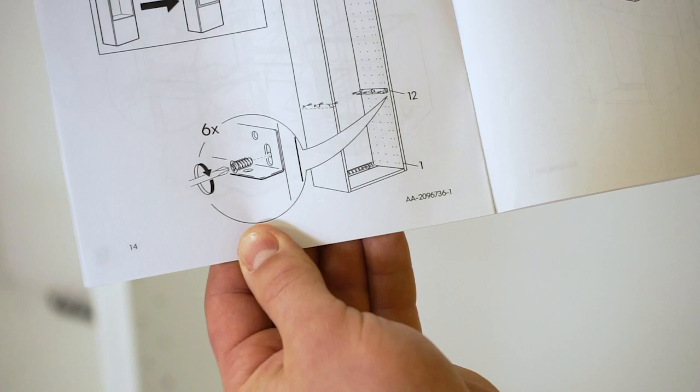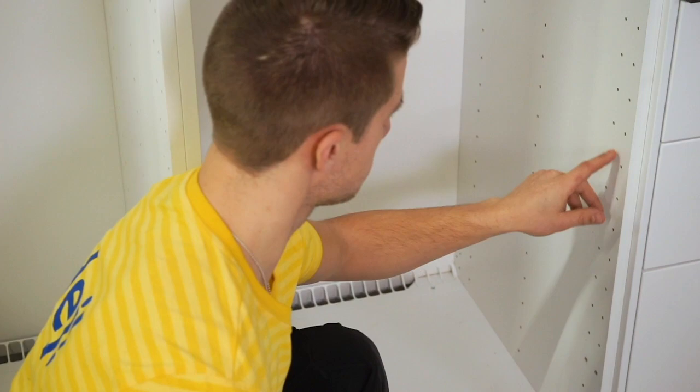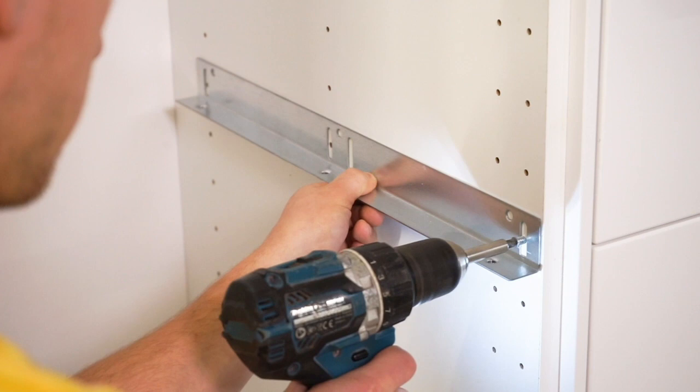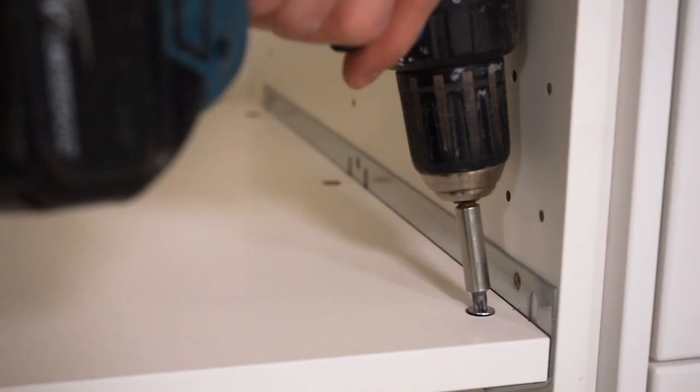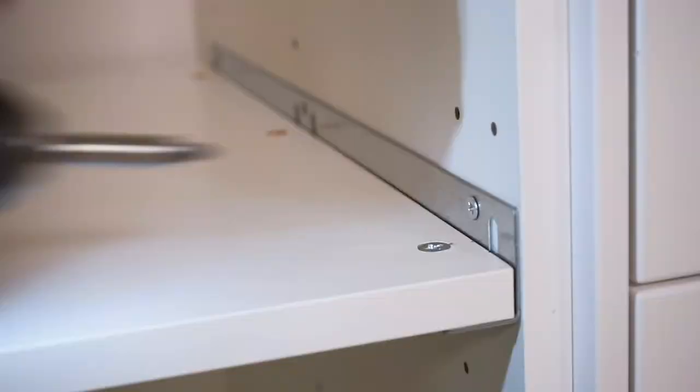Count to find the right hole to use for the reinforced shelf on which the oven stands — in this case we're using the 12th hole. Measure carefully and check the assembly instructions to make sure the shelf is at the right height. Install the shelf by screwing it to the rail, and fix the rail with the screws included in the oven package. Place the oven onto the shelf and use the screws to attach it to the cabinet.